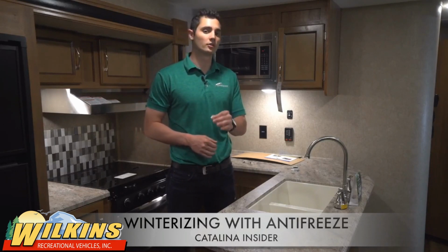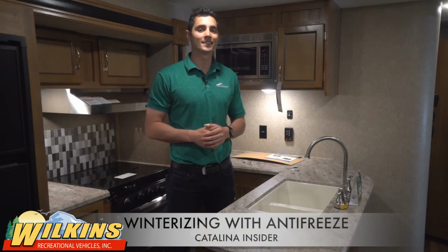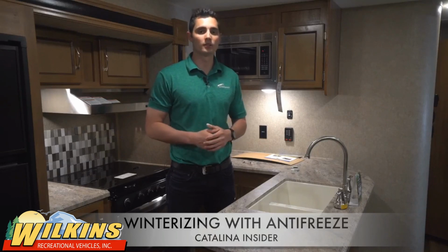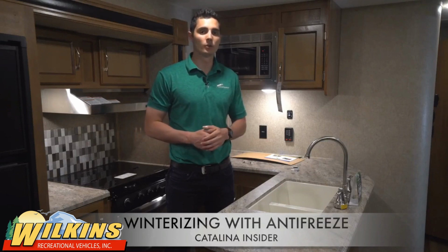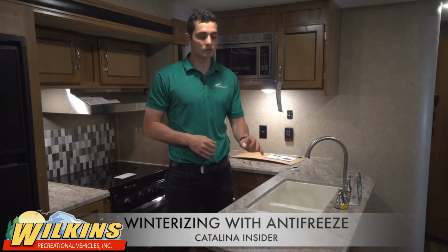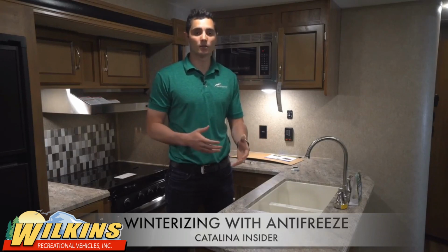What you need to do is purchase 2 to 3 gallons of RV non-toxic antifreeze. This won't harm or contaminate your water lines. Before starting, also make sure that your water heater is off and cool to the touch. Now, the first method that we're going to demonstrate involves using just antifreeze, not compressed air.